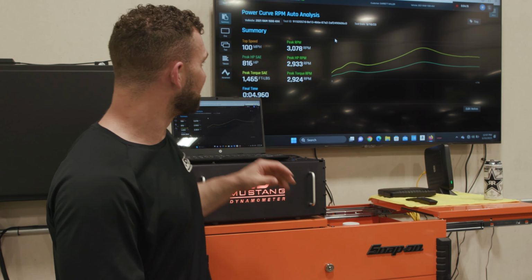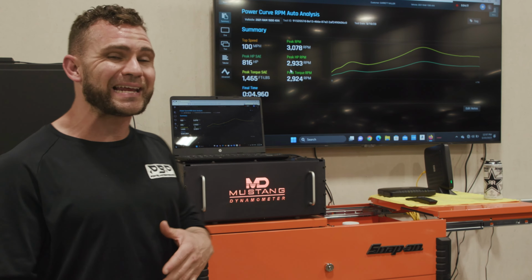Now, how does this thing drive? Well, if Garrett was here, the owner of the truck, he would probably agree with me. This is one hell of a rig to hang on to. I took him out for a spin in this, and let me tell you something. That 0.90 A/R housing, because this torque comes in low, 2,900 RPM. This thing will rock. It is fun to drive.